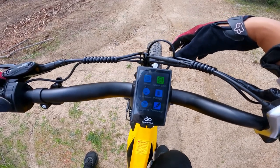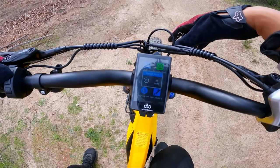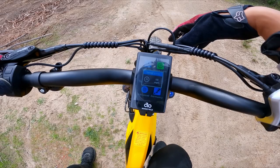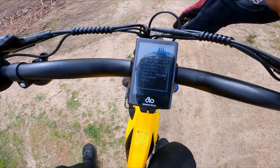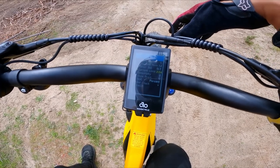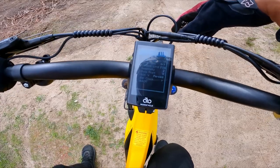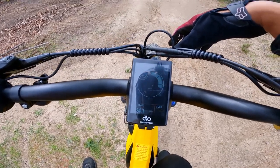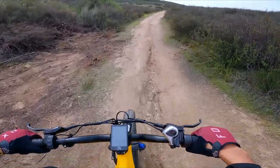We're in the settings now. Let's go to the speed limit — it was at 20, we're going to bump that up to 28. The current limit — let's see if we can up the current. Nope, so max amps is going to be 22 amps on this bike. I would love to see a 25-amp controller on this bike. I think that's all the settings we needed to change — now we can hit the max speed of 28.